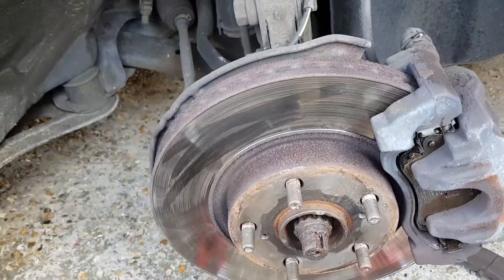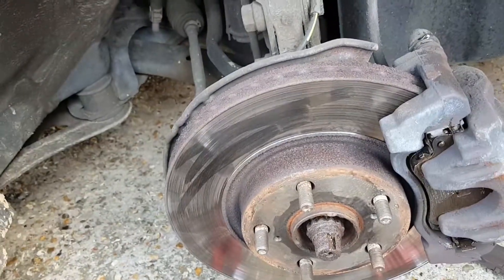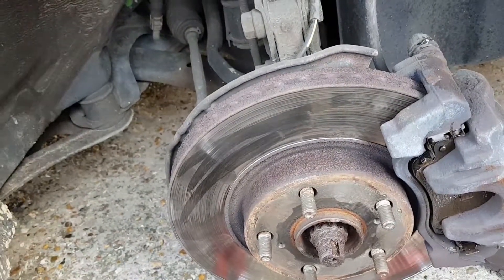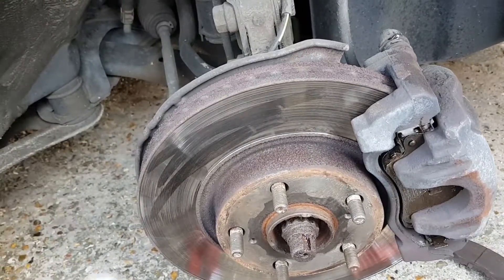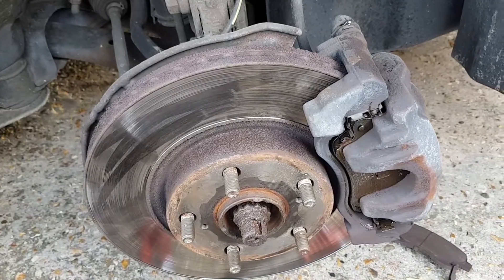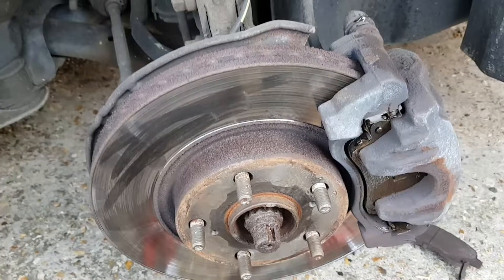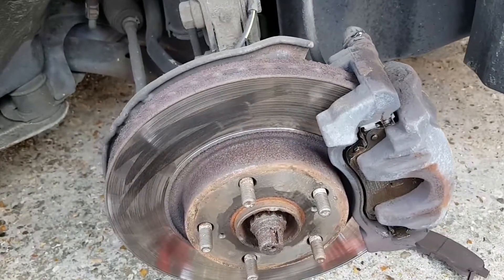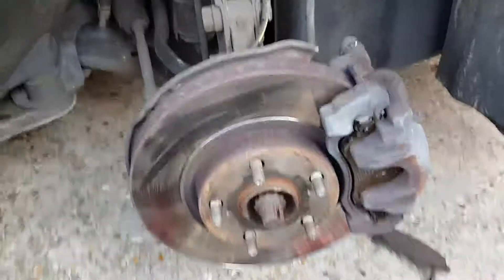If I didn't do that, I could take the handbrake off, go for a test drive, put my foot on the brake and it goes straight to the floor — then I could roll into the road or there could be pedestrians walking by. So just make sure whenever you touch the brakes, always pump the brake pedal and make sure you've got a firm brake before you try and drive the car. It'll probably take about two or three pumps to the floor, so don't be alarmed by that — just keep pumping to get pressure there.